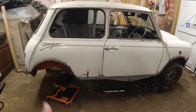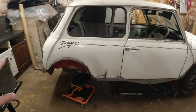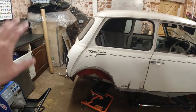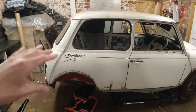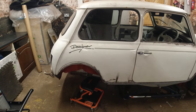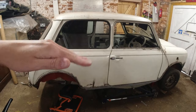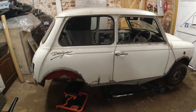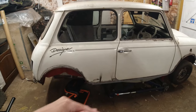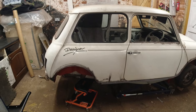Now to do that I just lift the jack up and it tilts, but I've got no weight at all in the back here. There's no suspension, no subframe, no fuel tank, no boot lid, a window missing, no seating — it's derelict. And ask me how I know this because I found out the hard way once: if I lift this up and tip it, the whole car is going to slide forwards because there's just not enough weight to create the friction to stop it from sliding. So I'm going to put a ratchet strap around here first and then I'm going to jack it up.